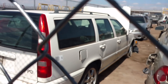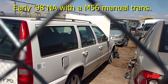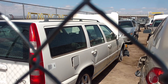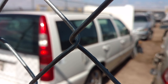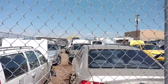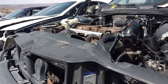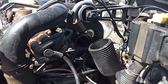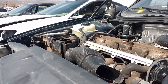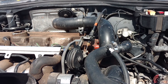Here comes another Volvo — this one's just a V70, 98 model. Looks like it got hit really good in the front, stuff out there laying on the ground. I can't tell if it's a standard or auto, but it's got a dark interior so it should have some decent parts in it. I'm going to go ahead and check my tool on this 98 Cross Country — it's already got the cam sensor off the back. I just need to pull the distributor and the timing belt cover, set the timing right, and put my locking tools on there.